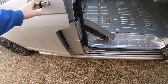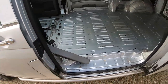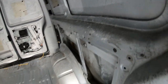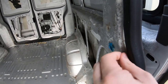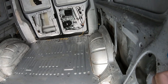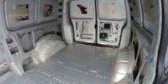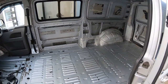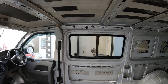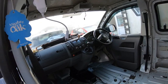I've removed the plastic trims and the steps — they just need a good hoover out, they were really dirty. I've also used a gas flame torch — the kind you use for melting solder when doing plumbing — to go around and melt all of the fibres so that they're melted down. That gives me a relatively smooth panel to stick to instead of trying to stick it to a load of fluff that's caught in the carpet glue.